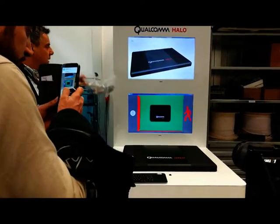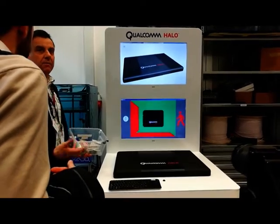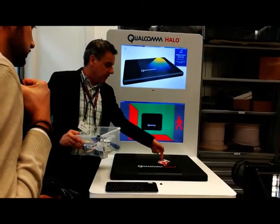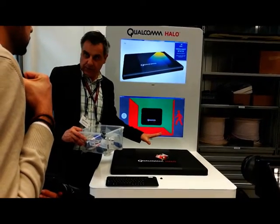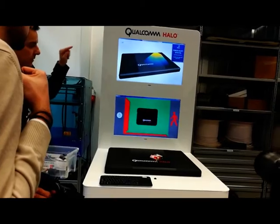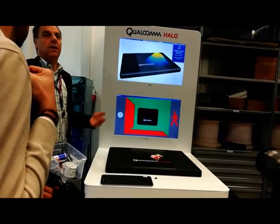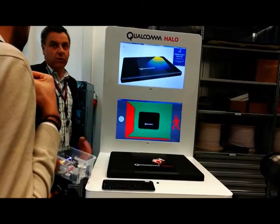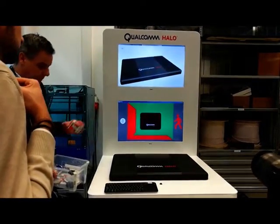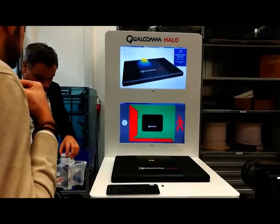Foreign objects are any kind of material that has permeability — for example, ferrite or aluminium like a cigarette box. If you throw a cigarette box onto the pad, it must be detected because the aluminium could become hot during power transfer. It is detected even with a high thermal threshold. So we switch off the base pad, switch off power transfer, and notify the user by smartphone: please come and look under your car — a foreign object has been detected and charging will not continue. Even small things like a battery or a coin must be detected.